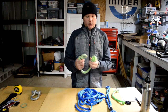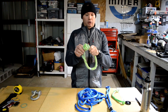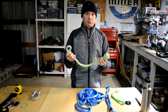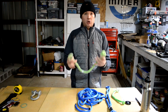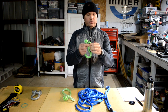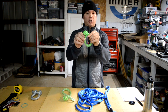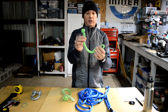I'm not recommending that you make your own soft shackle. If you don't make these properly it could break prematurely, or the knot could crumple under load causing the noose to slip off during a recovery. It's probably more advisable to just buy one, but good quality soft shackles can be quite expensive. From what I've seen in break tests, these soft shackles usually break at the contact areas under tension — just below the knot or in the noose itself.